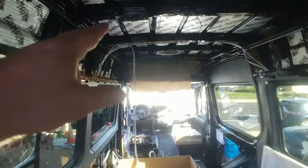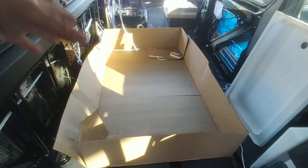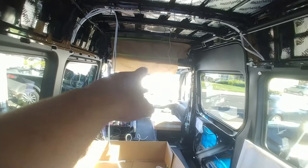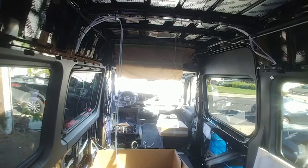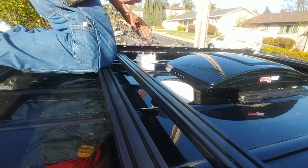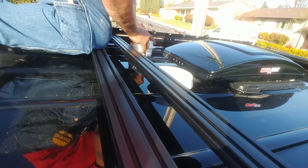When you're drilling for the fan, make sure you have something underneath because a lot of metal shavings are going to come down — we're using a big cardboard box. If you're cutting near the seats, make sure you use some kind of protective tape or paper so it doesn't get stuck in the fabric. For the fan install, go ahead and take measurements and trace everything out using those four indentations you made.